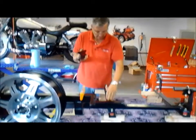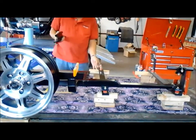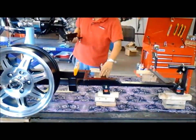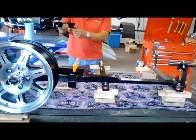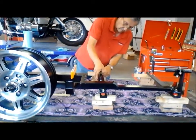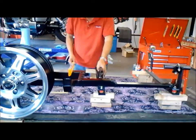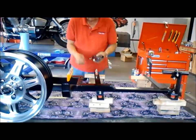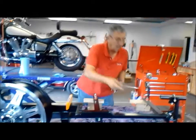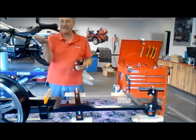This cross piece — cross pieces on the 1200 and 1500 Gold Wings are 32 inches from the outside corner to the outside corner. They are half-inch thick steel and two inches wide. They act as a spring as well as being used for attaching. These bolts have slotted holes — you put that there and snug it, not real tight. Use lock nuts also. These are 9/16ths — the 9/16ths wrench is the most used wrench in the whole deal. The U-bolts, bushings, and attachments are all 9/16ths.